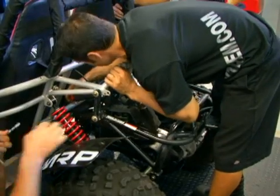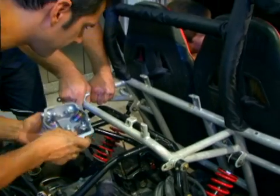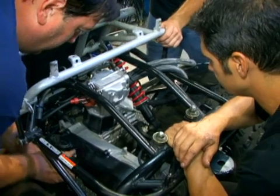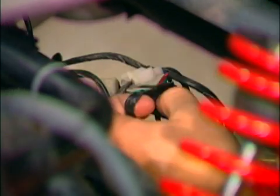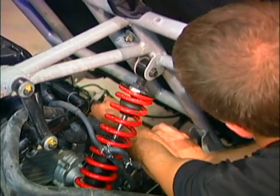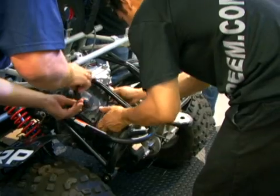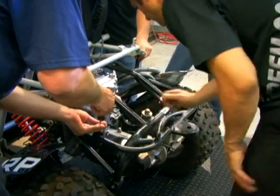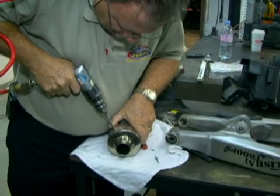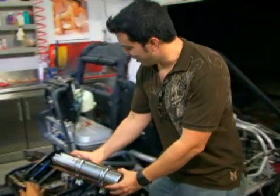The reassembly of the new parts went at record pace. First was the ported big valve head. Then on to the lightweight Kevlar drive belt. You can't add all that horsepower without a rev limiter, so Chase installed the MRP high performance unit. More fuel in needs more air. The stock filter and airbox were just not up to the task. They simply had to go. More fuel and air must escape the engine, so a performance exhaust was the final piece to get this go-kart up to speed.